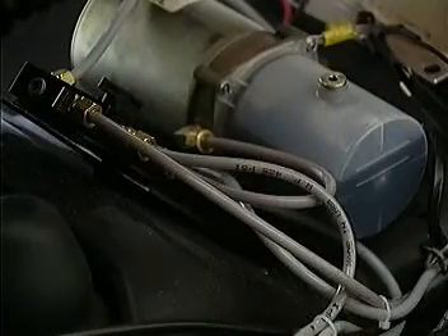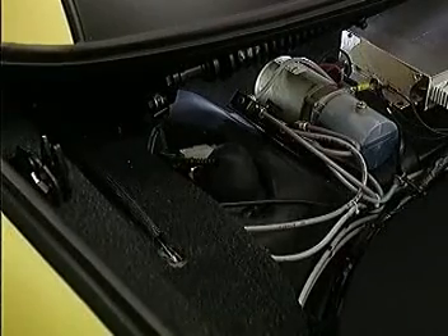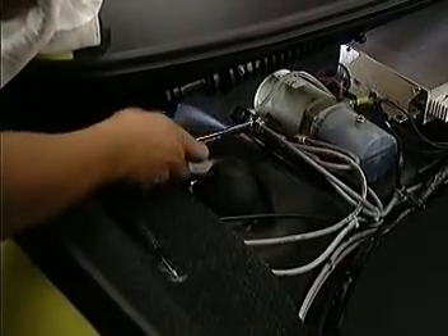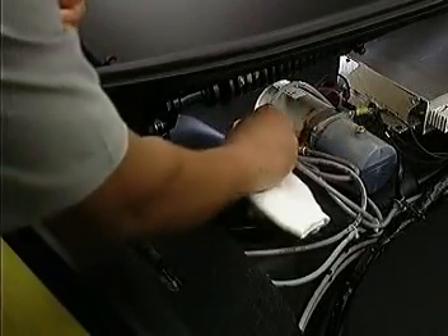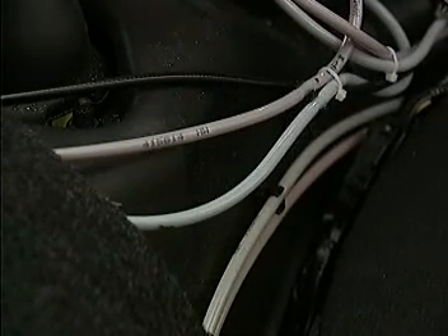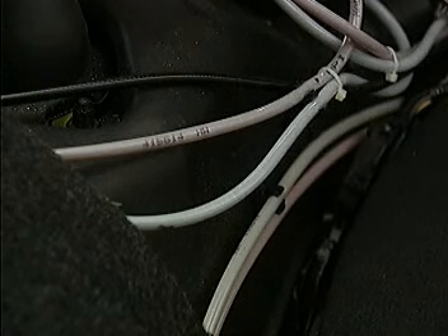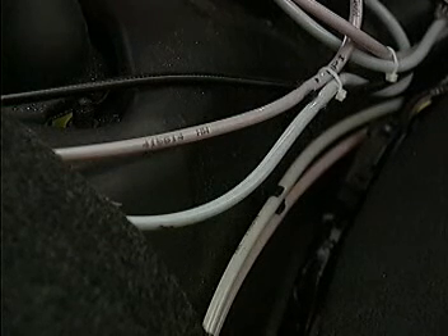Hydraulic connections are made at the pump motor, at the manifold, and at the hydraulic cylinders. If any leaks are observed, tighten the fitting to specification, clean up the spill, check fluid level, and add if necessary. It may also be necessary to bleed the system after repairing a leak. Note that the hoses come in two colors — white and pink — and any disconnected hose must be returned to its original point of connection. None of the hoses are interchangeable, and a cross connection will not allow correct top operation. Check the Spider service manual supplement to verify proper connections.